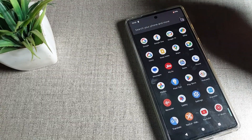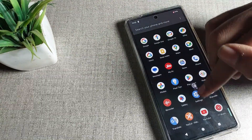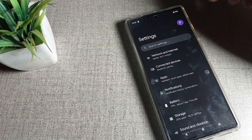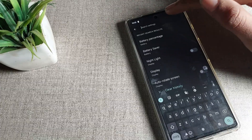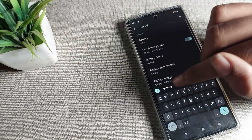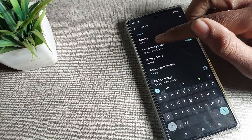You can use this battery saver mode setting to save your phone battery. Alternatively, you can click on your phone settings and use the search bar to search for battery settings. Once you see the battery saver setting appear in search results, you can tap there to enable it.